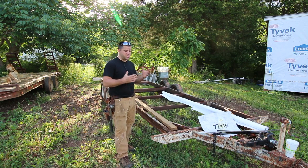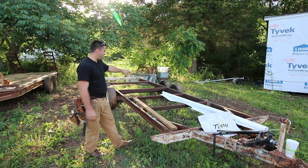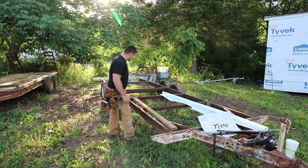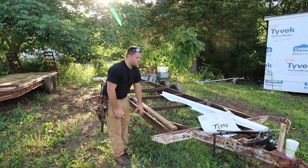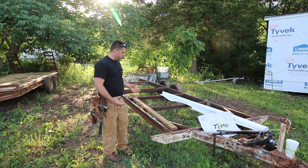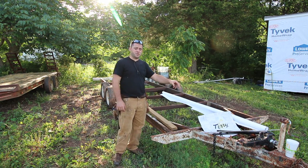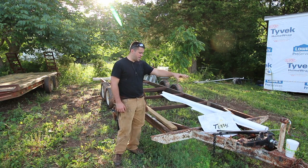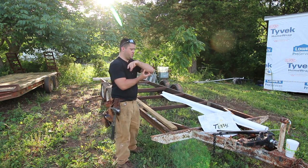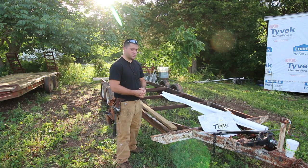What I've decided to do is build a deck on top of the trailer. This is going to cut down on my headroom inside the house, but I do have drop axles on this trailer which gives me about six inches. So if I build a deck on top of this I'll still end up with similar headroom to my regular house. I'm going to prep this, cut everything to length, cut off the brackets I don't need, get it sandblasted, and then in the following video I'll be spray painting it — a coat of primer and one or two coats of black Rust-Oleum paint.